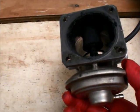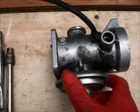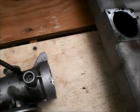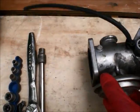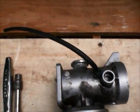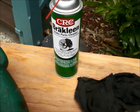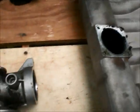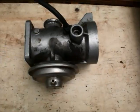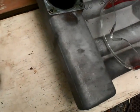So how will we clean it? Because the EGR valve doesn't have any electronics on it, it's a purely mechanical thing. I will use brake cleaner. I went to Napa to buy the EGR cleaning spray but they didn't have it, so I bought brake cleaner — I have two of them. What is important for your safety: you should wear gloves, and really important are eye protection glasses.